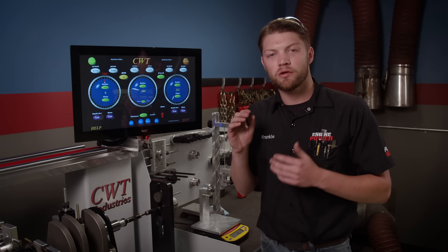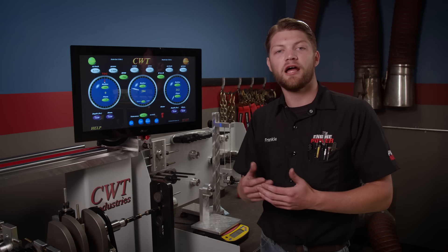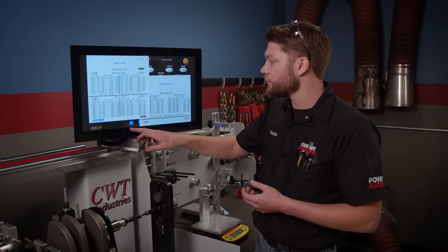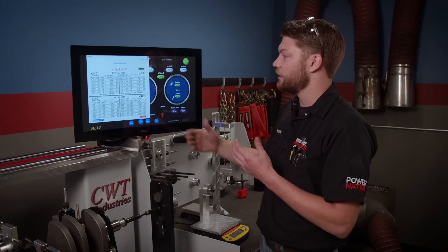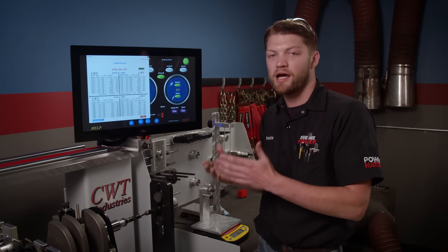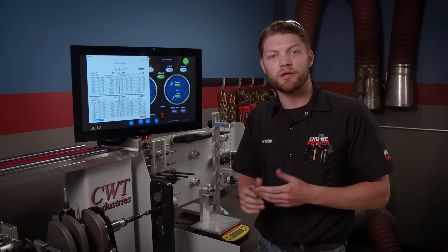That eighth ounce-inch might seem a little extreme to some of you. Back in the day, quarter ounce-inch was generally held as the standard for high performance and racing vehicles. But nowadays with modern technology like knock sensors, a lot of factory cars come way lower than that. When we started, if this crank turned 6,000 RPM, it would have 80 pounds of force on it every revolution. Now that we've balanced the crank within our tolerance, at 6,000 RPM we only have 7 pounds of force on the crank — literally more than 10 times less. That's not only great for the crank but for all the parts that swing around it. We're going to get it off the machine, polished, final cleaned, and it will be ready for final assembly.